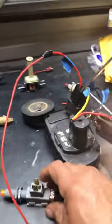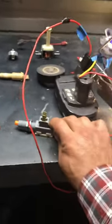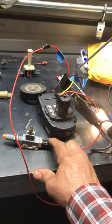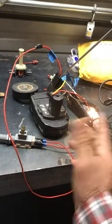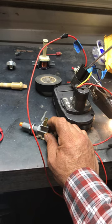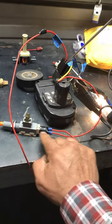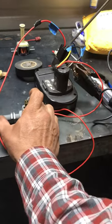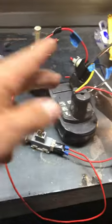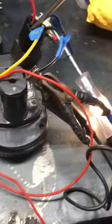Another way to do it is to use one of these type of brake switches found in a GM car that has cruise control. The bottom part would be wired the same — you don't mess with your existing car wiring. Power comes in at all times and then this power otherwise goes to your brakes like it's already set up. On this other circuit, you run power to one side from your ignition and then the other side goes to your ECU or transmission. This one only has power when you hit the brakes, while this one up here has power all the time but when you hit the brake it cuts the power — it'll do the same thing as a relay.